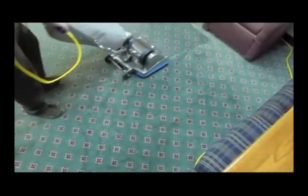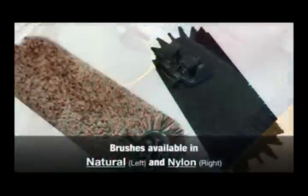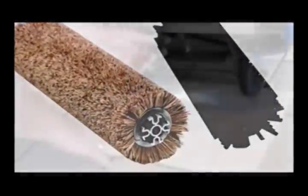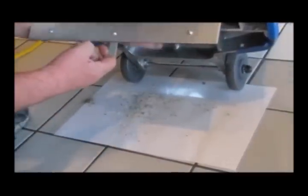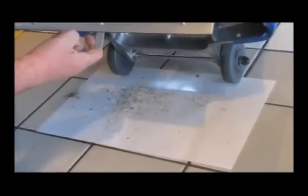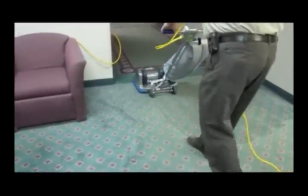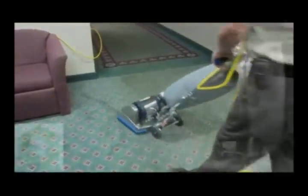The certified pile brush works on both a sweeping and vacuum action. The 15-inch brush gets down to the base of the carpet fibers to break up caked, embedded soils and dry particulate matter, which are swept by the brush into the sand trap area. Once in the sand trap area, all of the heavy particles such as pebbles, paper clips, sand and tacks rest in the sand trap. The vacuum motor then pulls the smaller, lighter particles into the vacuum bag. This process keeps the larger particles from being pulled into the vacuum motor and causing damage.